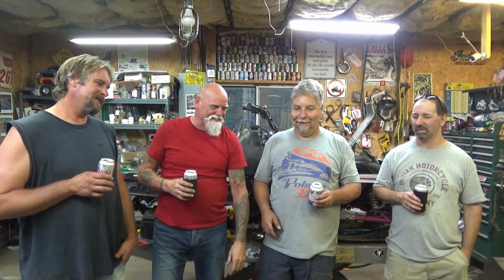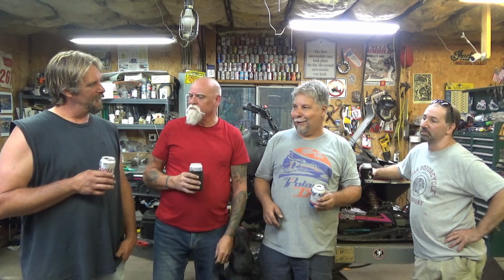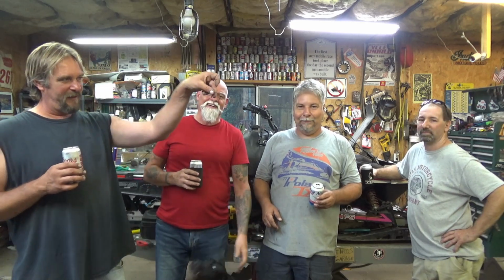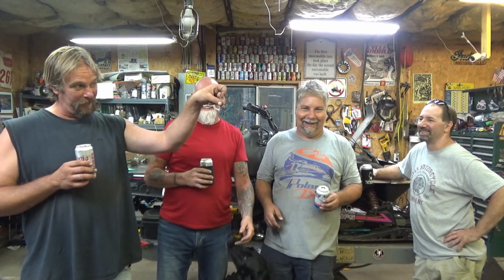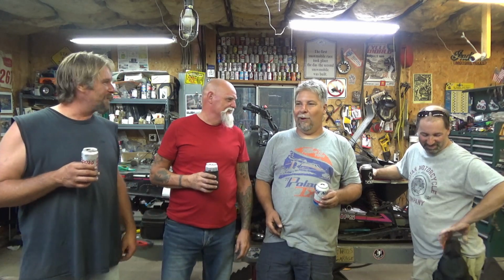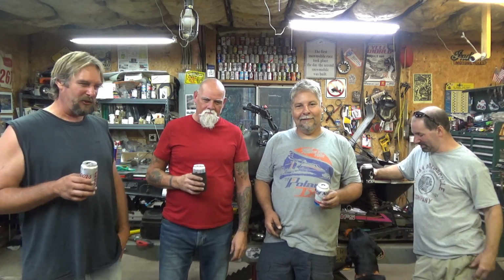But, yeah, things went good. Brad, you want to show them the O-ring again? Brad just noticed this after it ran. It's kind of like a broken condom, with a lot of leaks. Yeah, there's some badness there. I don't think that's gonna seal. That was my bad, probably. I probably jammed that water pump on. We were both there. I think it was the pressure in the fitting.